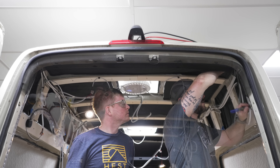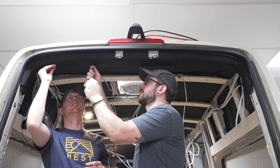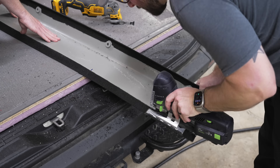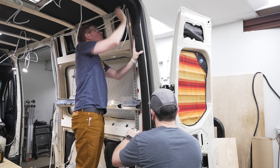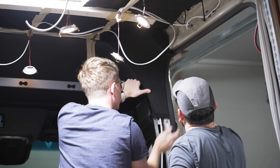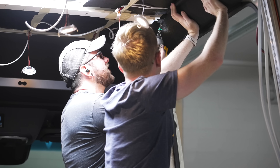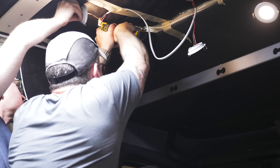We installed the topmost piece first since the pillar pieces lap onto it. I did need to trim away a section of the furring strips for this piece to fit, but once that was done it was as simple as adding the included bolts to the rivnuts. When we went to install the D-pillar transitions, they again interfered with the furring strips, and this time we trimmed the transition pieces instead since I wanted to make sure I had something to attach the plywood wall surface to later. Once the pieces were installed, it's pretty amazing how big of a difference this made in the finished look inside the van. We also installed the B-pillar and sliding door transition pieces, which were a little finicky because we were using the cargo version of the Sprinter van. These pieces attach to the ceiling ribs with a few sheet metal screws, and the ceiling shiplap pieces will overlap the edges.